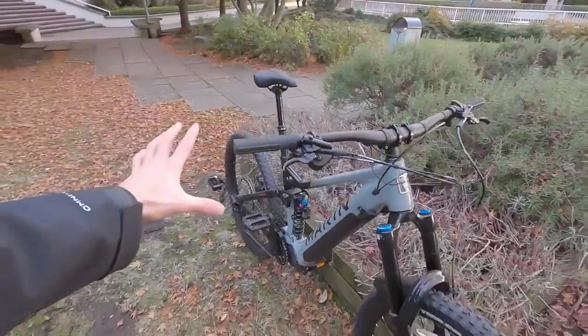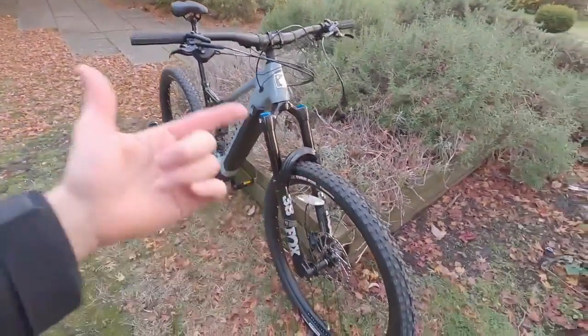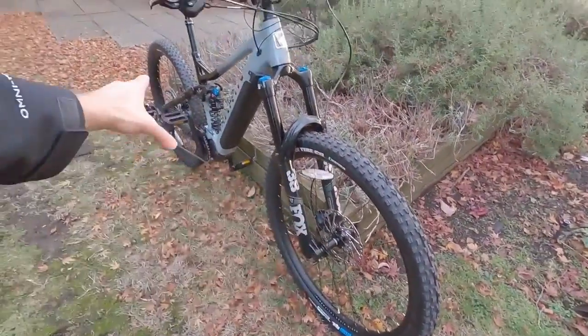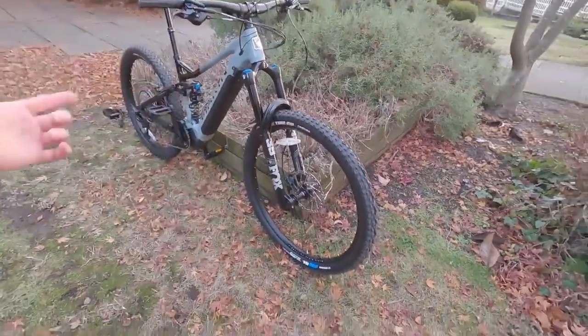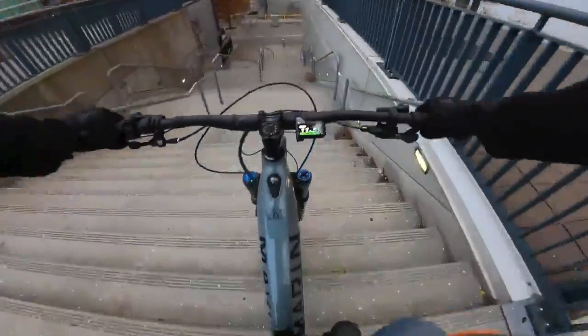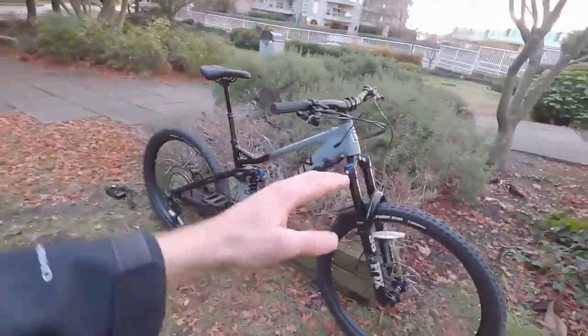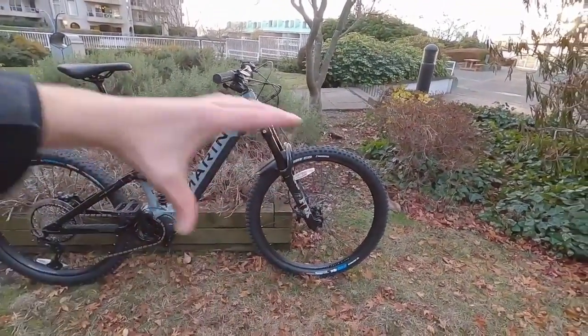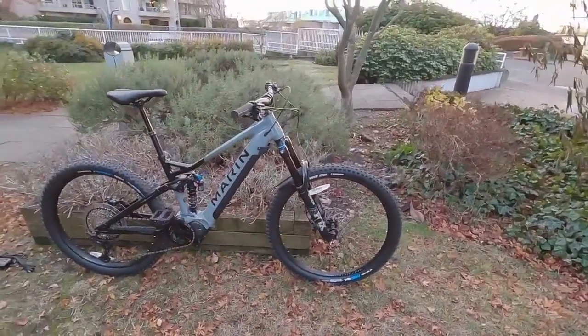I just wanted to explore this and share some of the trade-offs that I'm noticing. So we've got awesome brakes. These are Shimano hydraulic SLX, 203 millimeter rotors front and rear. So you get really excellent cooling, a great mechanical advantage, especially for something that is a little bit more aggressive. You'll notice the rake here. So it's slacker head tube angle, and you can really absorb those hits if you're going downhill, doing that all mountain enduro riding.